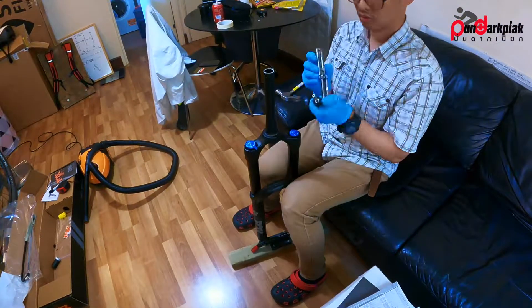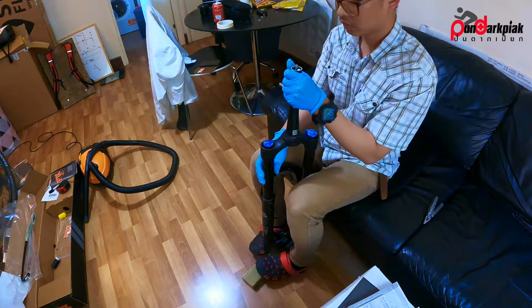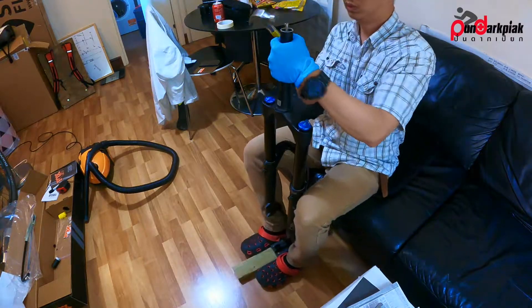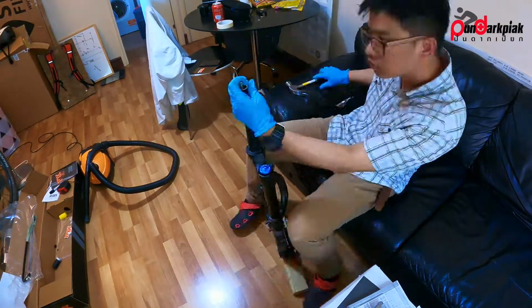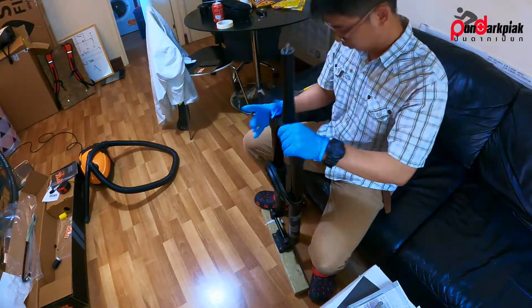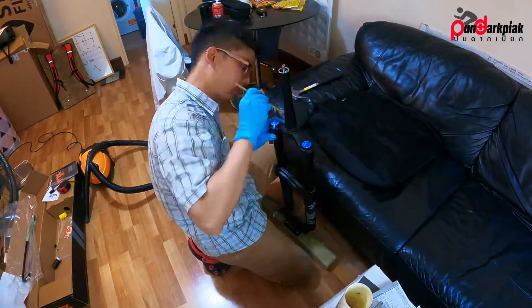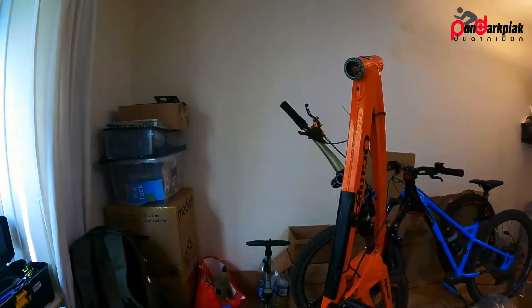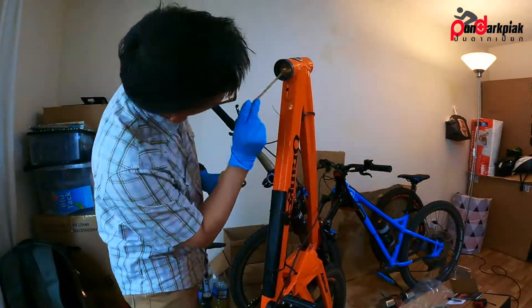I made sure to hoover the whole place and clean up the edge after cutting. After that it's all about putting the star nut inside without the proper tool, which is annoying — a lot of tweaking and hacking to do. Then I grease it up, put the crown race on, and grease the headset making sure everything is alright.